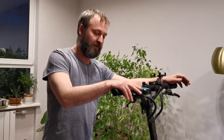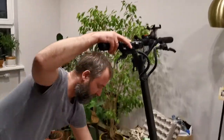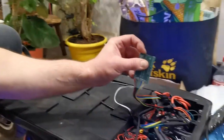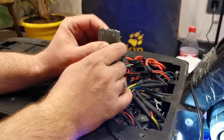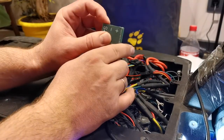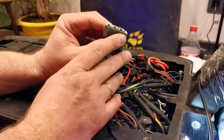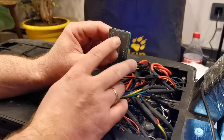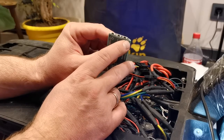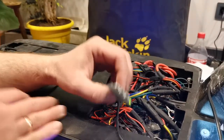Now the setup is that we have the full power mode locked by password. But now we have to turn on the limited mode. So I turn off the power, press and hold the set button to enter the menu, and turn on the power. I go to the second menu item — I press the plus button once and check that the LED flashes two times. I press the set button. I see that the LED flashes one time, which means limited mode is not used. I press the plus button to turn on the limited mode — it will be unlocked. I check that the LED flashes two times and press the set button. Confirmed.